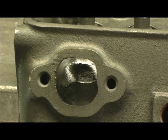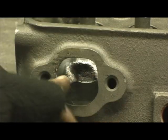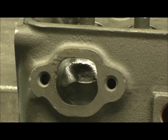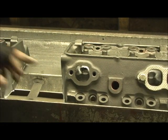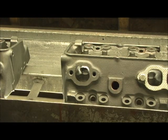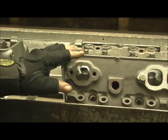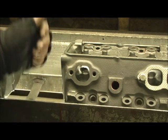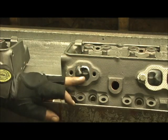This is one of those times I really can't do anything to it, but it won't hurt that much. Basically, they were already semi-polished, so I'm going to go in with 120 grit, polish them up, and clean it. I will do a little short turn work when I do the valve job — I noticed a bit more unshrouding was needed, so I'll work the bowls in the short turn a little better. Otherwise, you'll have to catch me on another iron cylinder head, like a 186 or even a TBI head, to see how hard I hit the exhaust.